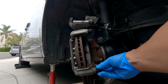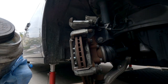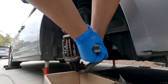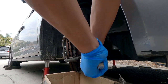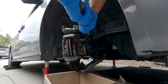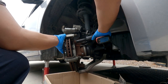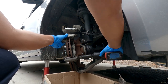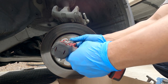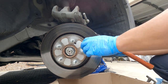Get the bottom caliper pin, snap it in, and get the air out of the boot so it won't cause a bubble, pop, or burst. Now we can start taking off the two 19 millimeter caliper bolts. We're not using these rotors again so it's okay to give them some love taps to get them off.